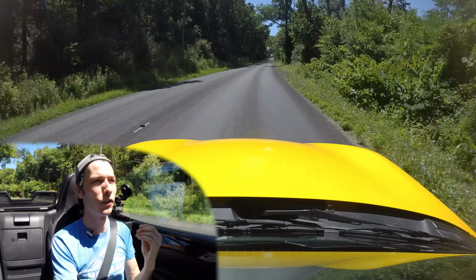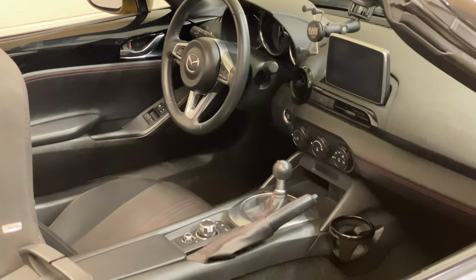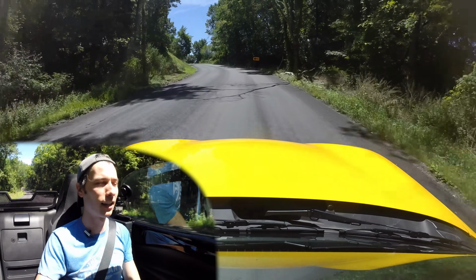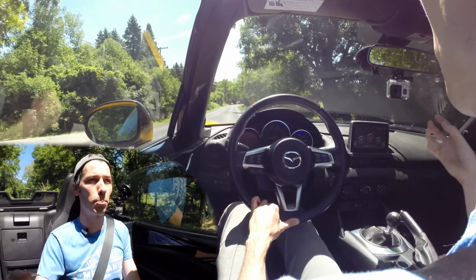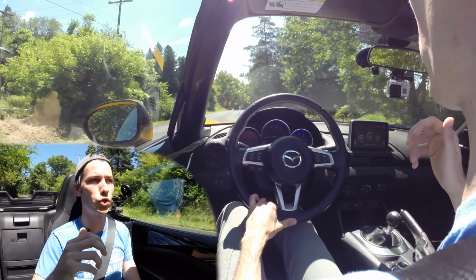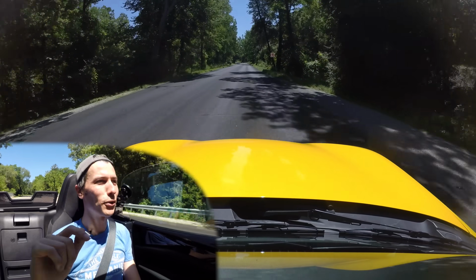That's what happens. So another really big challenging thing from a design standpoint is when you design an automatic transmission, you can control almost everything, right? You can control how it shifts, when it shifts, that sort of thing. With manual transmissions, that control is taken out of the engineer's hand. So they have to design something that they think will work well and they think that people won't ruin. But they can't control how people drive. And I'm not trying to blame this on drivers. I'm just saying with a manual transmission, part of the reliability equation is put on the driver. There is a portion of it, because you can trash a manual transmission very quickly if you want to. If you genuinely want to destroy it, it's not hard to do. With an automatic, it's quite a bit more challenging because there's so many controls in place to prevent that from happening. All right, enough ranting about the transmission.